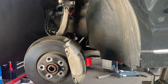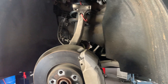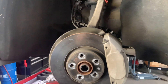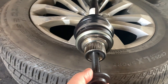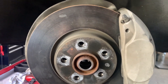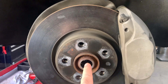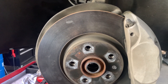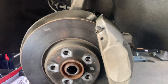Hello everyone, this is a 2015 Audi Q5. This video is about how much the axle bolt should be torqued. You gotta torque it about 150 foot-pounds of torque and then an additional 180-degree turn. That's how you torque the axle bolt.